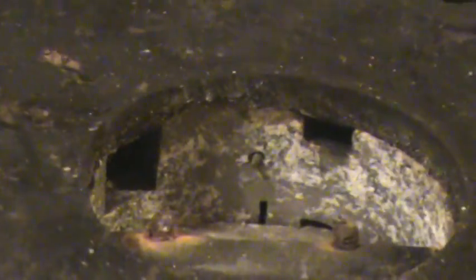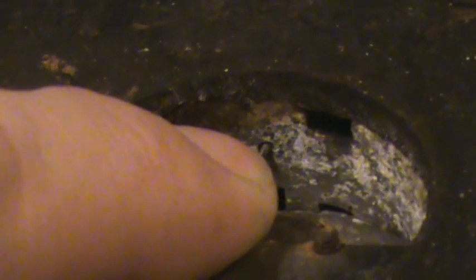Now, if you look at the bottom side of the carburetor — this has still got the gasket on it, but I can show you. Here's one. This carburetor is pretty dirty. That mixture screw, the other end of it, protrudes through. There's a passage behind that. You see this little tip right there? Out where my finger is — it's just a needle and seat arrangement, basically. It tapers, and as you screw the mixture screw out counterclockwise, it emits more fuel into the idle air mixture circuits, where they get drawn into the engine through the manifold.